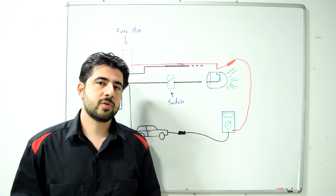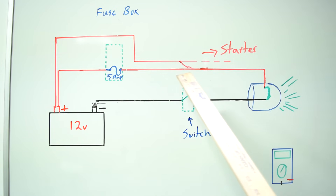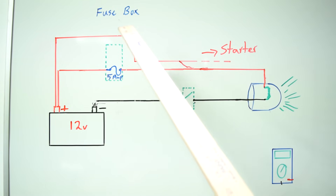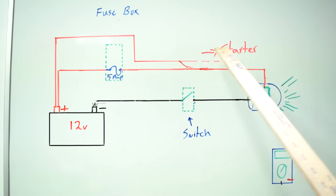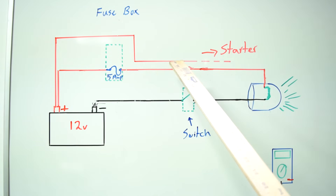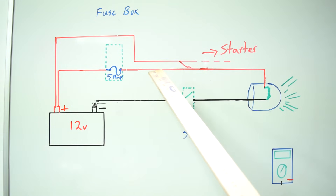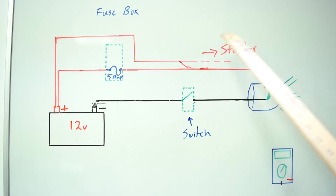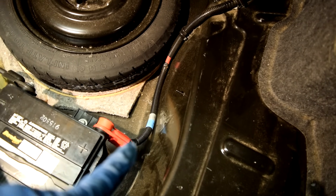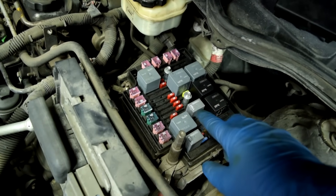Alright, so that's how you diagnose a positive short to ground. But obviously it's also possible to have a positive short to positive, although in my limited experience that usually doesn't cause a fuse to blow. For the fuse to blow on a particular circuit, the power side of that circuit would have to come into contact with the power side of a separate circuit that has very low resistance and is pulling a lot of amps — like the power cable that goes to your starter — coming into contact with the power wire for a circuit that only pulls maybe 5 amps. This is rare because the starter cable goes directly to the starter and is well insulated and not bundled with other wires.